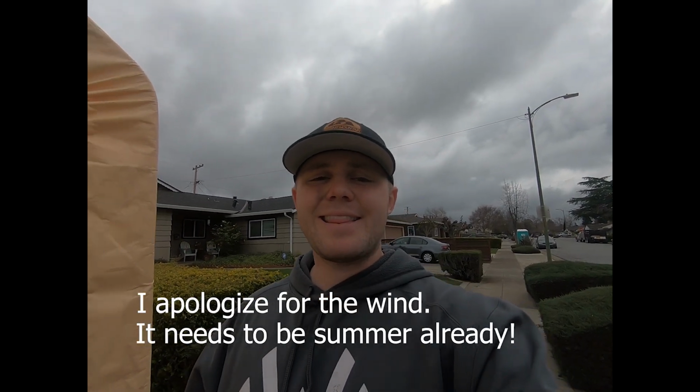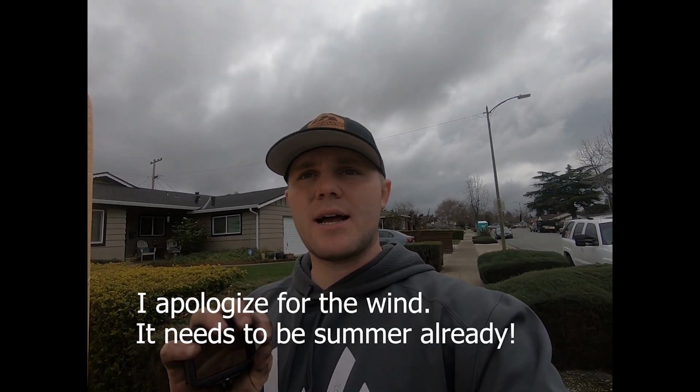I'm going to go over real quick basically what you're going to need for the swap. So Bohan, I don't even know how to pronounce it. It's Bowman Customs, I believe. I forget what the Instagram name is. I'll put it down below, but he's the one that sells the kit that you can do the swap with. It's a very good kit, comes with everything you need, and it's super simple, super straightforward on the swap. So you're going to need his kit, and then you're going to need to buy 2009 to 2014, I believe, CTS-V rotors. You can either do the 6-piston or the 4-piston kit. I chose the 6-piston kit, so you have to get the 6-piston Brembo calipers.